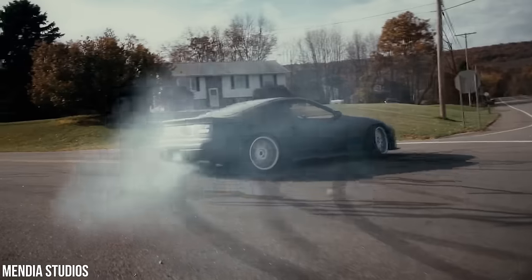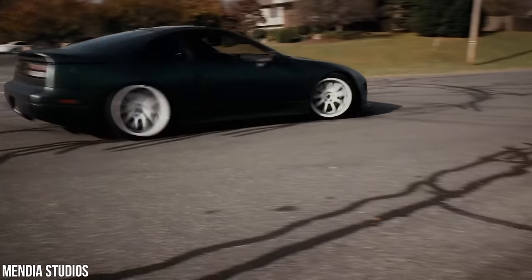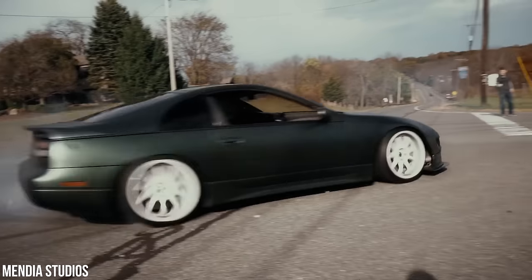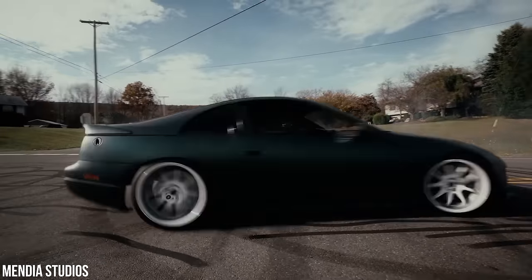The NA cars are heavy and slow, but still fun. The twin turbo versions are heavy and less slow, but tough to muscle around. If you don't really get the whole weight transfer thing — if you turn hard, the weight transfers in the opposite direction of where you're trying to go at one and a half tons. This does that a lot. The lower you get the center of gravity, which on this thing is going to help loads — it's just going to make the car feel way better.